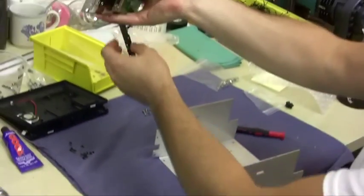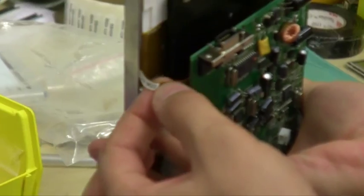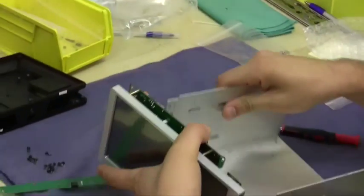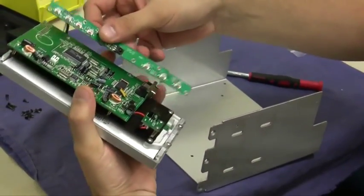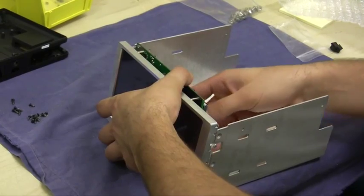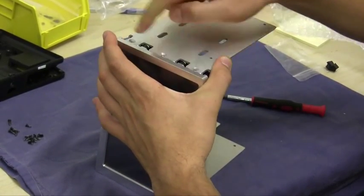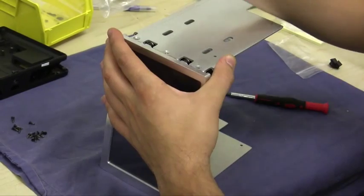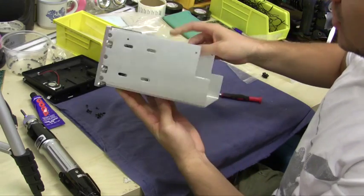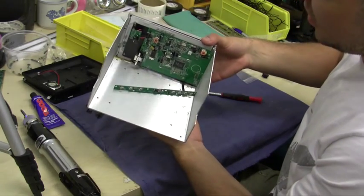So when you mount it, where the touch screen ribbon cable comes out — that's your bottom of the monitor. So what you do is make sure your back plate is behind the PCB board and you kind of slide this whole thing into the bracket. There are three screws on each side and you're going to use the flat head screws. This is kind of how it looks, just to show it to you from all sides — this is the inside of the unit and the way it fits.